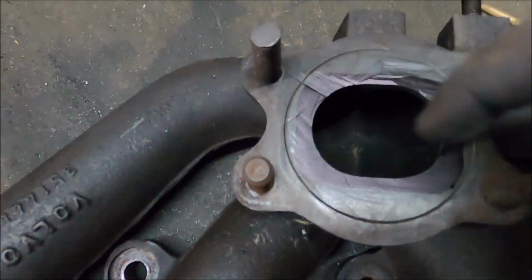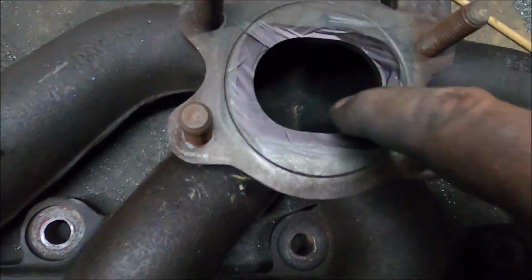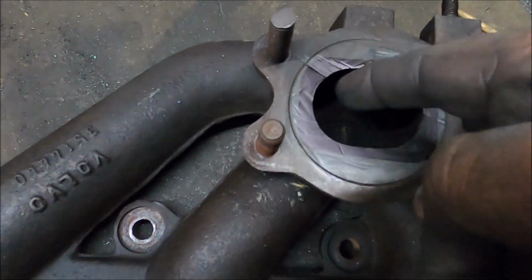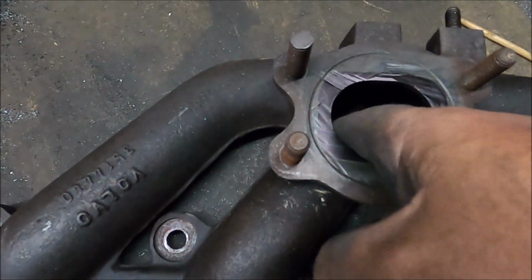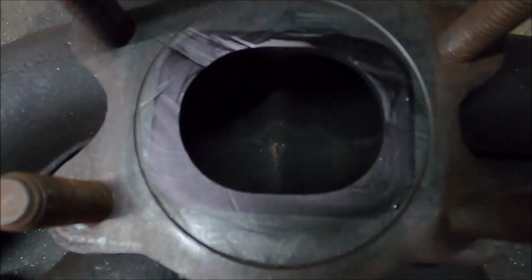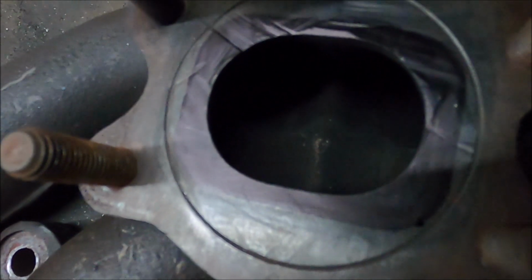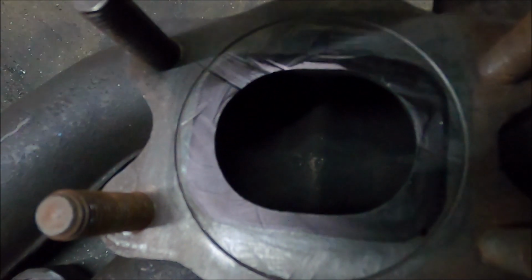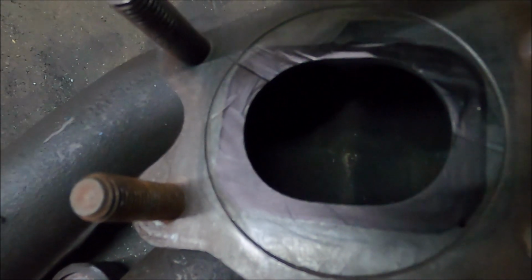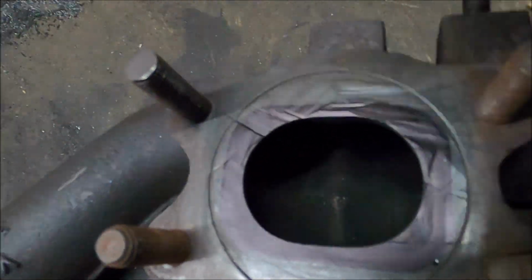They always talk about the short side radius, as in the inner curve, and obviously if you're taking out this, it's much improved, because at the moment it's going along then up, whereas if I'm removing it further along, the radius is much better, so they can come out of the holes and out. Because that's the thing, the biggest amount of meat to cut away is on the 4 corners, and that's where the exhaust gas is coming from. So no matter what people say, I am in no doubt that not just overall flow, but in general, opening this up to true T3 size is really going to help.